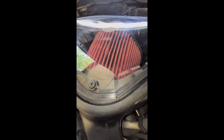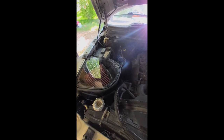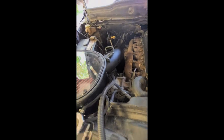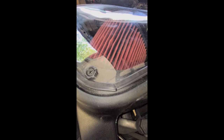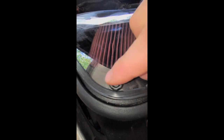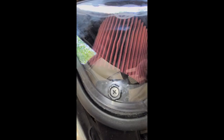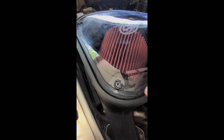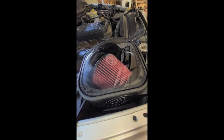She's done — MAP sensor's back in, everything's tight. I could not fix that gap, and you can see I cracked the plastic some, so don't over-tighten these screws. If I've got a leak there, there are two holes down there, but it's in there. The plastic's dirty because my hands are dirty.